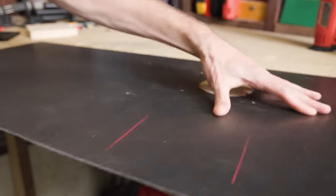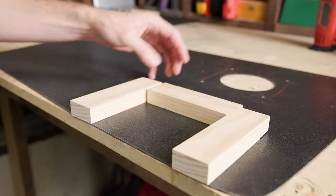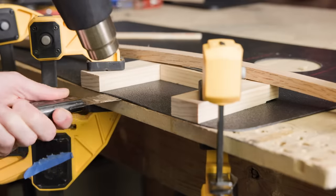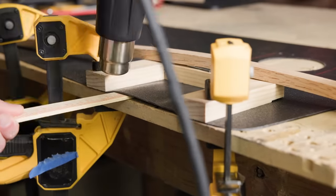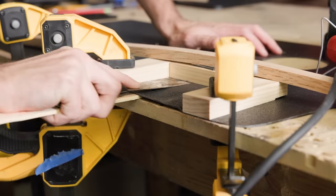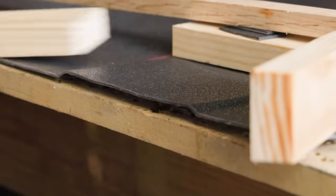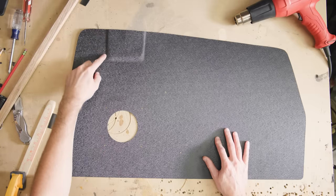But because the best part is no part, I decided to mold the snorkel into the sheet of ABS by clamping a few wooden blocks to it and using a heat gun to soften the material. This scraper helped me start to deform it, and then a stir stick that I sanded down was the perfect size for finishing the job. This stuff starts softening around 200 degrees Fahrenheit, so it's easy to shape with a heat gun, but that's a high enough temp that the heat of the sun hasn't warped mine very much so far. Here it is finished — just a few millimeters deep, and because our window only touches the window cover at the top, I only made the snorkel a few inches tall.